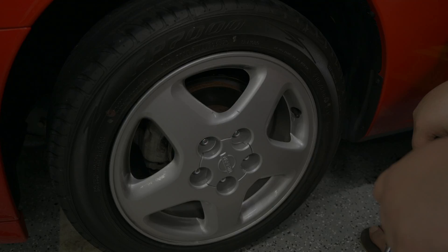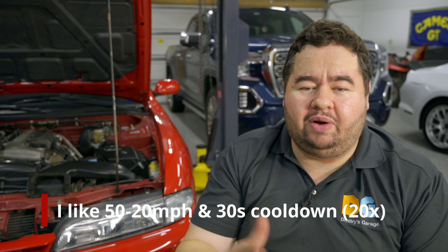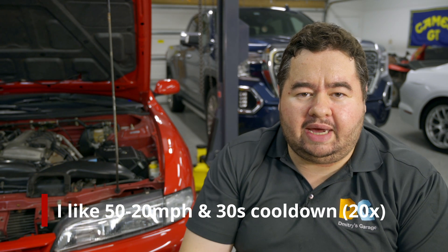And it will be time for a test drive. But before we go to a test drive, let's go over some basic guidelines. Get in there and pump the brake pedal to make sure that it's nice and firm. It may go to the floor initially — just give it pumps. Don't just go out driving and then realize you don't have brakes. You will also want to burnish your pads. This means you'll want to get to about 30 miles an hour and then slow down to zero, or you can go 50 to 20 or 50 to 30, something like 10 to 20 times. Don't panic brake — it's all about braking assertively but not overly harshly. You're not trying to beat them up hard; wait for them to burnish in to do that.